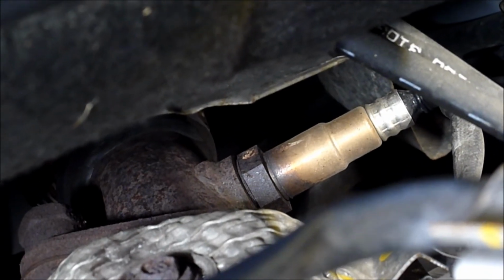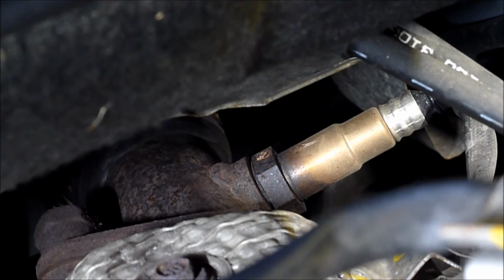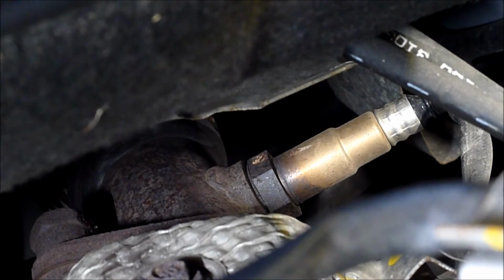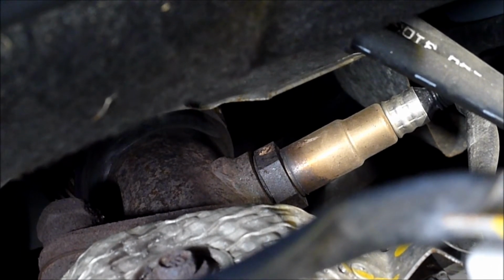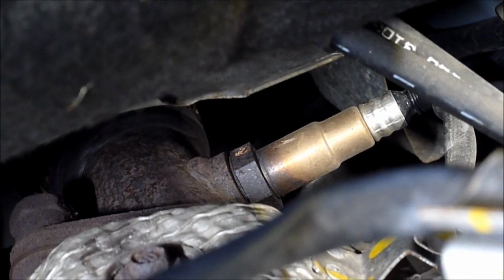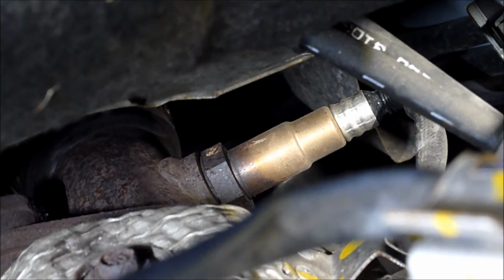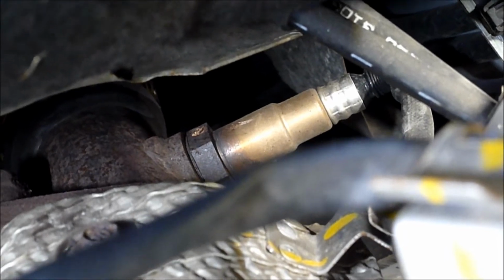So if you get both oxygen sensors showing identical readings, it's very unlikely anything other than a bad catalyst is the cause. So that's the post-catalyst downstream one that you're looking at, bank 1 S2 as it's known.